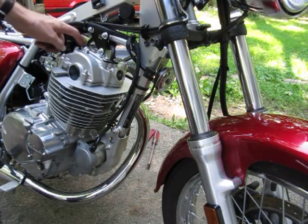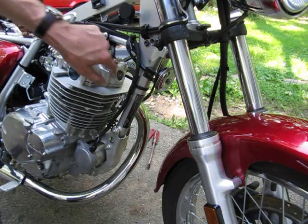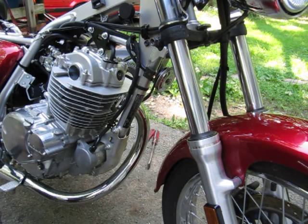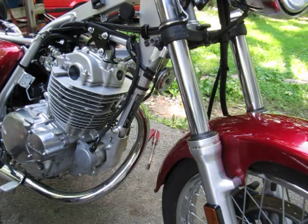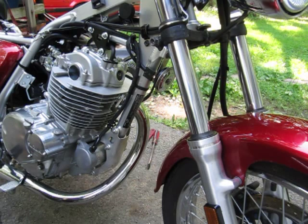For the back one it was a little bit loose, just like the intake and the exhaust was when I first checked it. But now 0.003 fits under no problem, and 0.004 just barely squeezes under there. For the back, I got it where 0.002 was just sliding under nicely and 0.003 would not go — so I think we're looking pretty good.